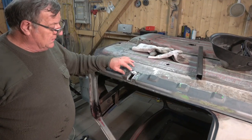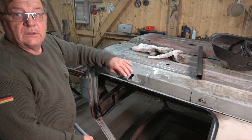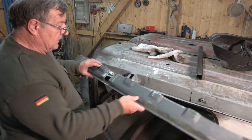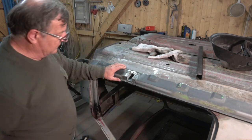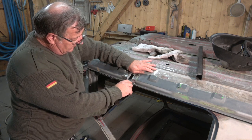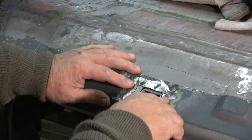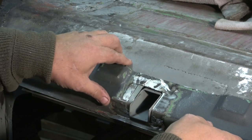What I've done is refit this because the square was too big — I had to elongate it. As you can see it's all welded in there now, absolutely solid. It's got four welds internally on the side and on the top, plus it's all welded in here — absolutely solid. As you can see, that fits right on the line. Once that's down, what I'll do is weld the sides. I've put some steel underneath it to bridge the hole, and once I weld over the top of it and clean it, you won't see it. I wanted to do that to give it a double thickness, so when I weld it against this steel box there'll be plenty of meat on it and it won't blow through.